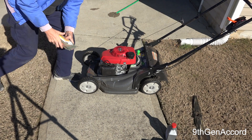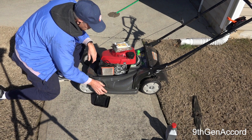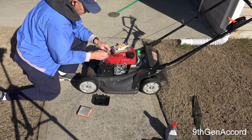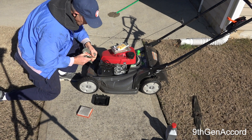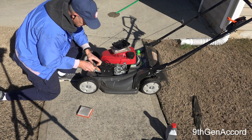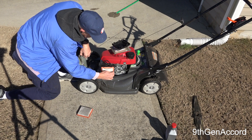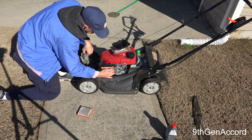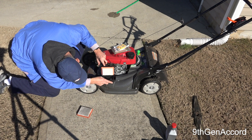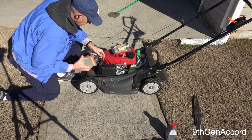The air filter right here takes absolutely no tools at all. You just snap these little tabs down and it comes out. Now this air filter is the original air filter — I did vacuum it out but it's absolutely filthy. I think it's important to use the factory Honda air filters because they're very, very good. I've already cleaned this out previously — that's the clean side — and we'll just take this new air filter. They fit very snug in here. Hook it back with the two little arms and then these go into the slots just like that. We've got our new air filter done.